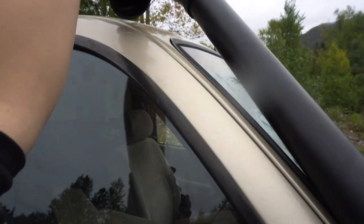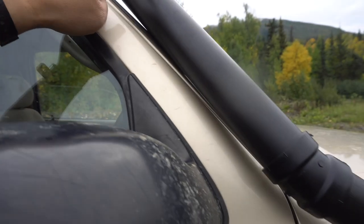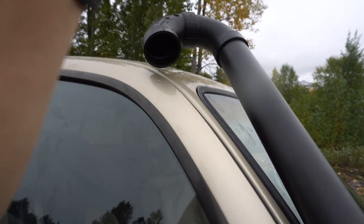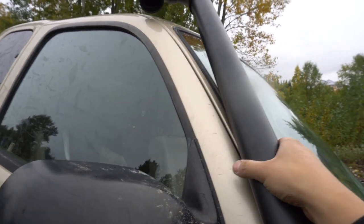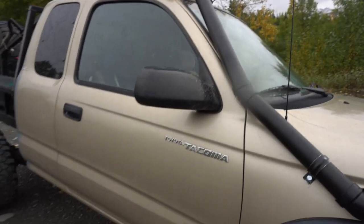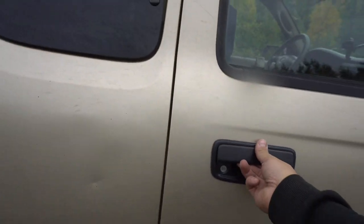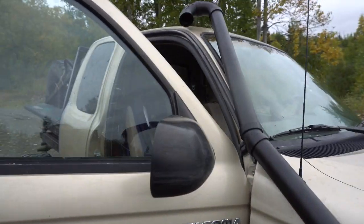So I'm going to shorten this because I feel like it's a bit too long — maybe cut four or five inches off the main pipe so it's flush with the roof. Everything right now is glued together with PVC cement. The only thing not glued yet is the nose piece, which I can always take off and do whatever I want. It vibrated more on the highway than on the dirt road. One thing you also want to check is make sure the door opens — you can see the door opened and doesn't interfere with the snorkel.